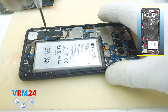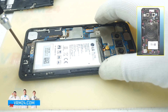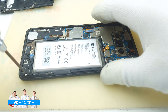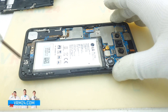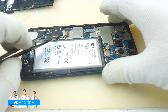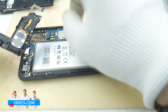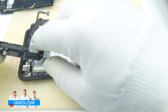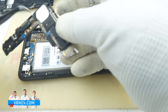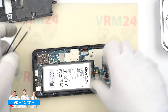We use the same Phillips 1.5mm screwdriver to remove the screws securing the loudspeaker and the assembly with the small boards. We disconnect the connector and remove the assembly with the antenna tracks and pad for devices — there's a loudspeaker and connections related to the second screen. You can Google and see how this model looks with the second screen attached — it opens like a book.